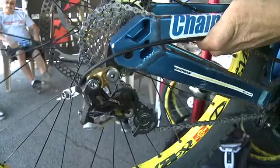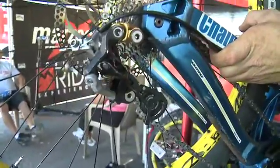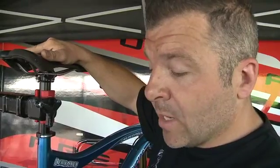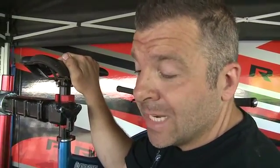Your axle to BB grows a little bit in length, so the chain has to have a certain amount of slackness to it. The reason why you need the chain to be at its perfect length is if it's too short, it will potentially rip the rear mech off, or you won't get all the available travel in your suspension because the chain will stop it.